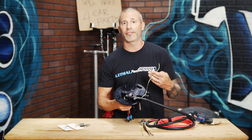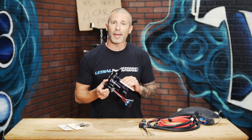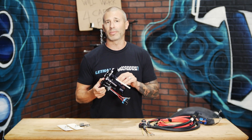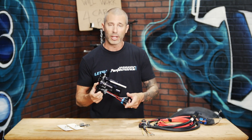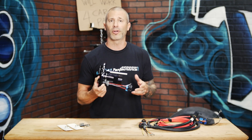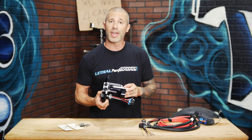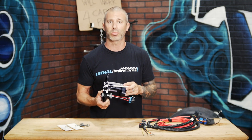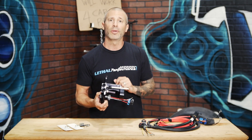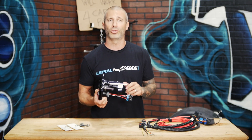The only thing left needed to do would be hooking up the level sender wires. Speaking of the level sender, this fuel hat accepts the 03-04 Cobra OEM level sender with no issues. It bolts directly to the spine of the fuel hat here and connects to the wiring on the bottom of our connector. If you do have a 99-04 GT or Mach 1 level sender, that requires the DX37011 level sender bracket. Simply hook up your OEM level sender to the bracket and bolt the bracket to the spine and it works just like factory.